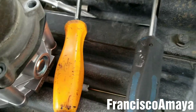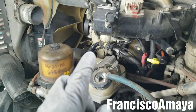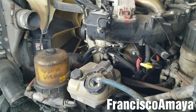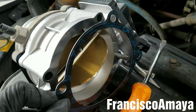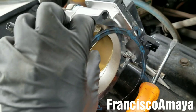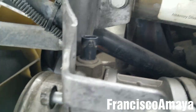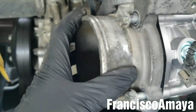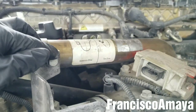I'm going to insert the bolts and install it on the intake manifold. Remember, before installing the throttle valve, you have to install the other gasket that goes in the rear area. Put it in the correct position, and make sure that the sensor points up — otherwise you have to remove it again and put the inlet in the right position.